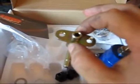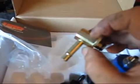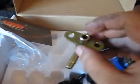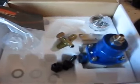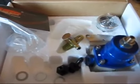This kit is labeled as the SR20 adjustable fuel regulator kit. It also works with the KA24E single overhead cam engine. The mount holes are the same, the port is the same, and the O-ring and everything. It all fits up nicely. This adapter has the barb for the hose connections, and then you have your pressure gauge. Rather nice kit, well made, good quality. But yeah, it's for the SR20. We're going to go ahead and show that it can also work for the KA24E single overhead cam engine.